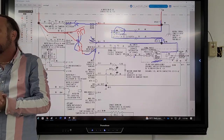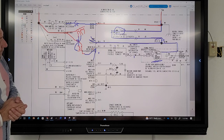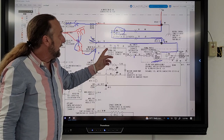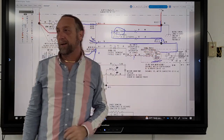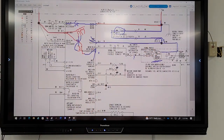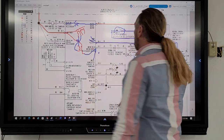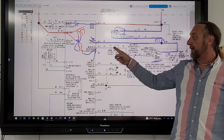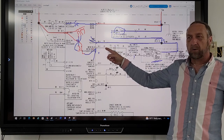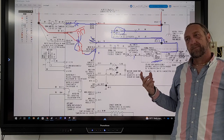And it'll be smart to test from TF1 to J8, right? I'm sorry, no, because now you're actually just going to put your ohm meter on here, and on here, and on there, by itself. You aren't testing the whole circuit. TF1 to J84 is only going to be like, okay, if I get a read here and I don't have a read here, that wire is broken. We determined that L1 is getting power through the board. That's where you're getting 120.